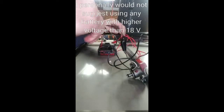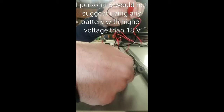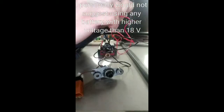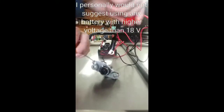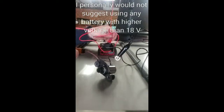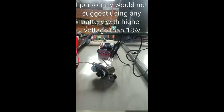I've found that this works for the Duty-A, the Duty-C, and there's another solenoid with a blue connector that I can't remember the name of. Here's the Duty-C connector — hook up ground first. This has a smaller terminal so you've got to get in there with the gator clamp. Duty-C is working just fine.